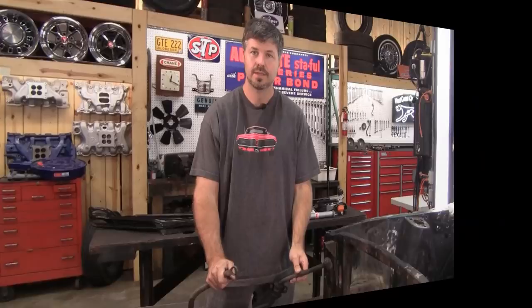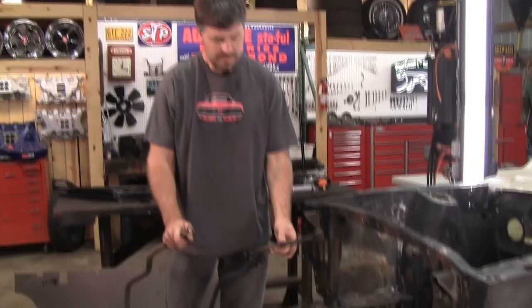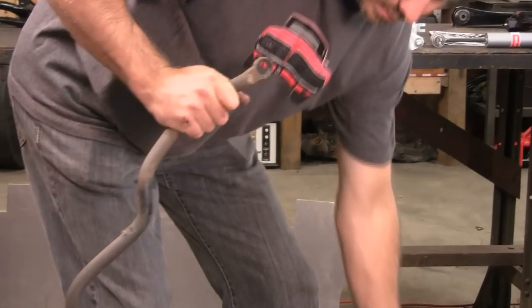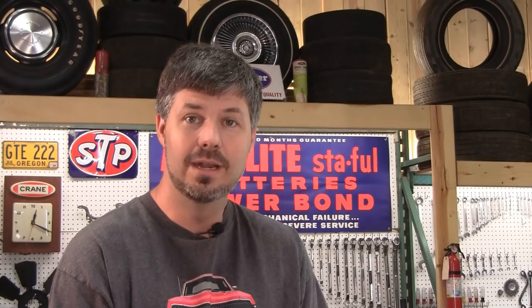Here's another inexpensive upgrade. The factory cars without the handling package or big block all came with really small sway bars. You might consider putting in a used heavy-duty sway bar — now this isn't the ultimate one like would have been in your Cobra Jet, but it's a nice step up. Be careful of overkill. So many people put inch, inch-and-an-eighth, or bigger sway bars on there thinking bigger is better. The problem is you're stiffening up the front so much — what's the rear doing? You can't do one end without doing the other. So if you're going to put a huge sway bar in the front, be looking at subframe connectors and an aftermarket rear sway bar.